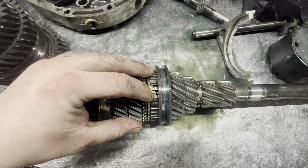I got your transmission apart on the bench here. I'll kind of walk you through everything I found, top to bottom, front to back. When we were loading it in the car, we found one of these looked a little bit off for some reason, or I pointed that out. Basically, I found a copper crush washer in place of where an aluminum spacer washer would have gone.